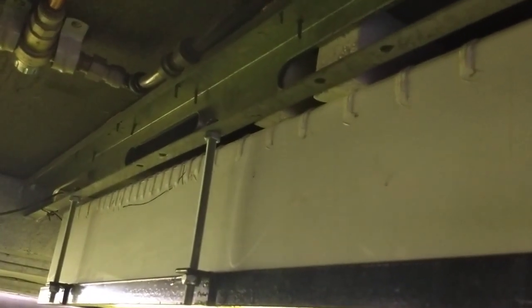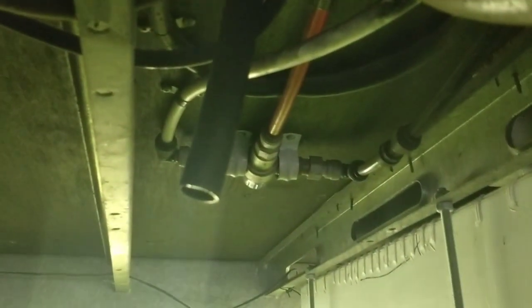This probably isn't an issue for everyone without this kind of custom setup, but in some places you have to watch your water pressure because the supply can be unpredictable. Since that problem happened, they've fitted this overflow system - a large plastic pipe that hangs down here. If the tank starts overfilling, it lets the water out so the tank doesn't over-pressurize and break again.